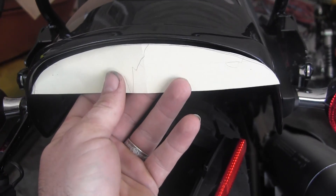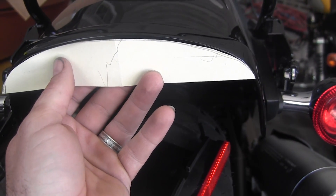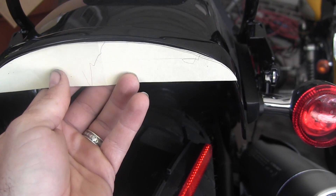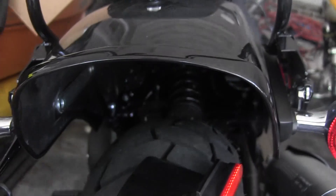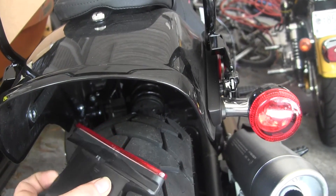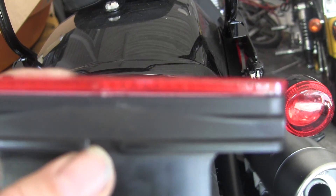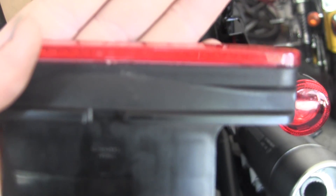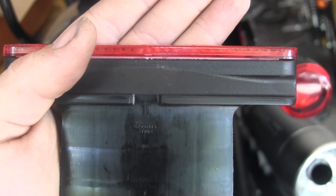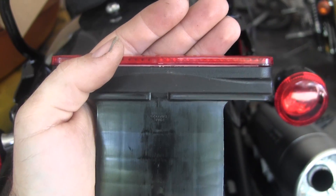Here's the pattern we've made for the back of the fender. I'll transfer that to some sheet metal, and if it doesn't fit perfectly I can massage it with a grinder or take off extra material. I'm going to assume this reflector is attached similarly to the front reflectors — it looks like double-sided tape between the reflector and the bracket. I'll take the heat gun to it, soften it up, and hopefully we can fix HD's mess and give this bike a really cool rear end.